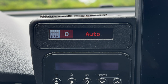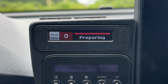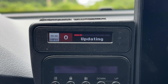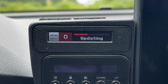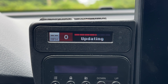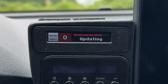I'm going to restart the detector and let it reconnect to Wi-Fi. You can see it just connected — I've got the white icon — and when it connects, it's going to automatically at startup go out and check for any firmware updates. I'll hit the up button on the control pad and it's going to start the update process. The GPS update process is definitely faster than firmware updates — you can see it goes pretty quickly. Firmware updates are bigger files and take longer. But this is the very convenient option because right at startup it can automatically check for any updates. If they're available, they just pop up on screen, you hit the button, and it updates as you drive. Just be aware that while it's updating, your detector is not going to be able to detect radar or jam laser. But once it's done, you've got the whole thing updated without having to check for updates manually or grab your computer and plug it in.